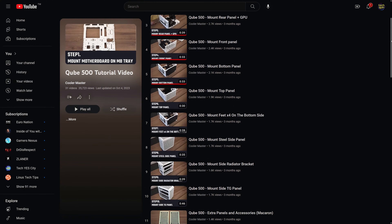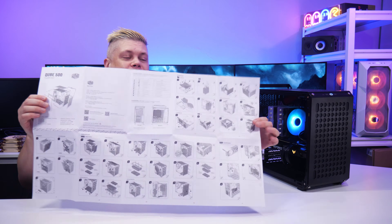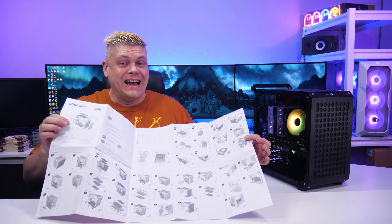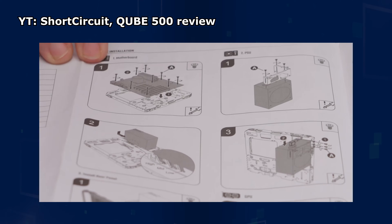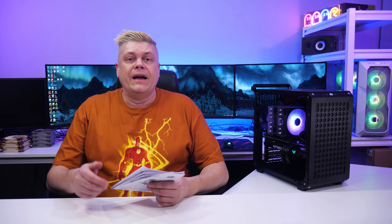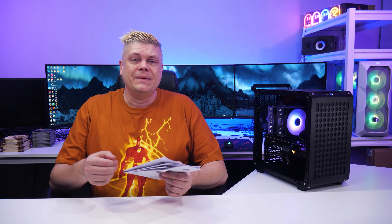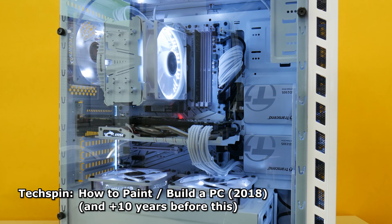There's no reset button, which is bad as you need it for troubleshooting and controlling fan hubs. And there's no fan hub. Good thing there's a video playlist, because the manual is an unwieldy large half-map size with small drawings, and it's not really understandable until you realize each folded rectangle is pages of a comic book. You know what would make this better? An actual IKEA-style manual with pages. You know it's bad when a YouTube video is showing you how to read the manual. Every case should have a unified front panel connector, but the manual doesn't remind you to hook it up during the basic build and it misses connecting the single included fan entirely. Even though I've been building for years, I was just following the manual and it caught me out.